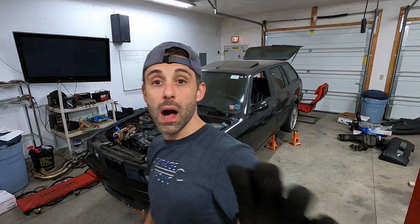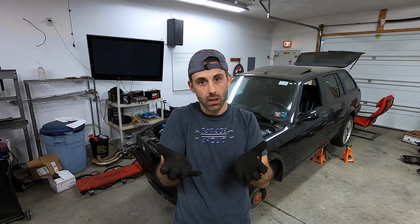All right, guys, now while we start working on the oil pan adapter bracket idea, which is what I had, which is basically a 20 millimeter thick oil pan adapter bracket that bolts onto the N54 block, but also allows the M50 pan to be bolted on from underneath, allowing the front sump oil pan to be used.